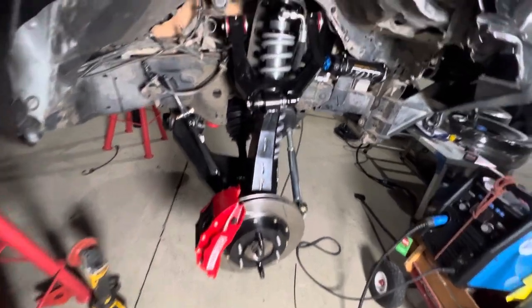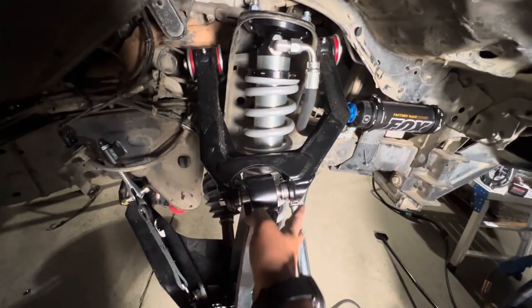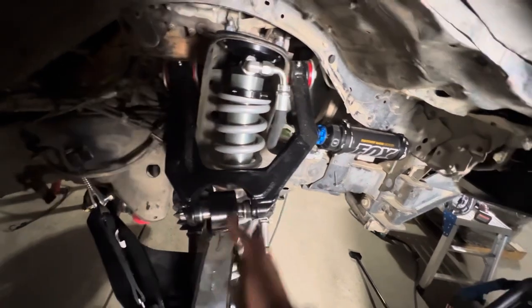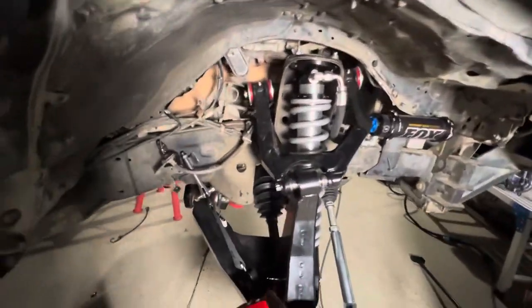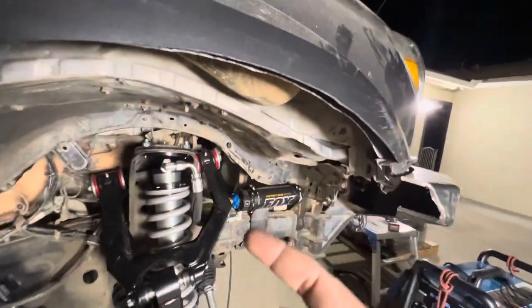I was kind of concerned about that and I noticed I do have a little bit of tire rub on this corner right here. I'm gonna check it when I get all my tires mounted and probably just take the tip off right here. I gotta turn it all the way and see how it looks. This side clears. As far as the up travel, I'm gonna have to extend this — I'm gonna take out about an inch of travel on the up travel so that I don't tear into all the plumbing for my snorkel, and on the other side it's gonna help me because I'm not gonna dip into the battery tray.